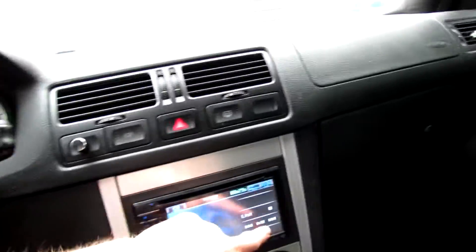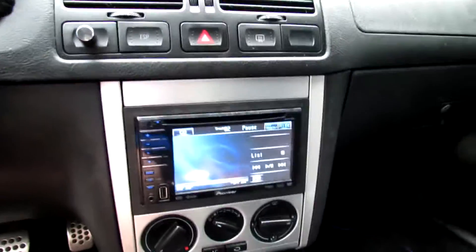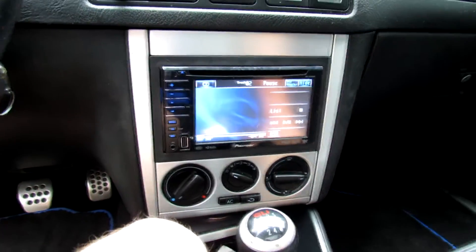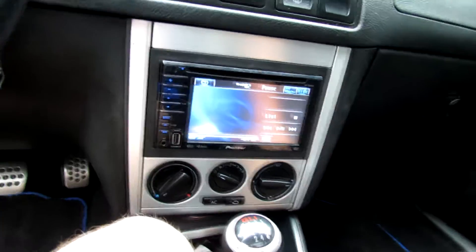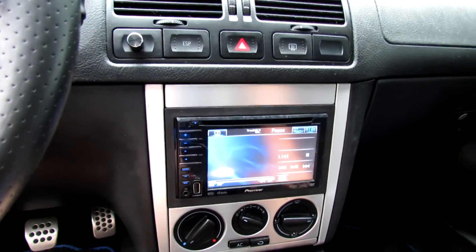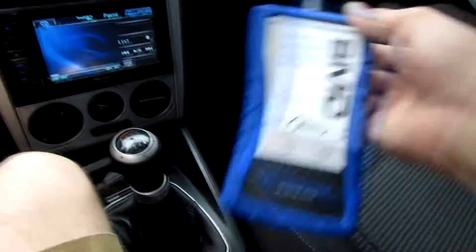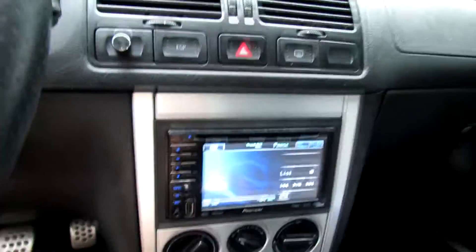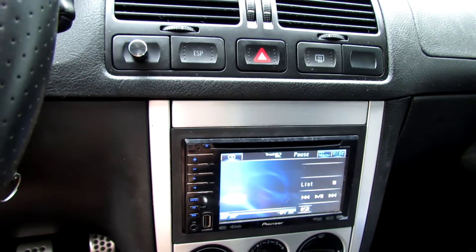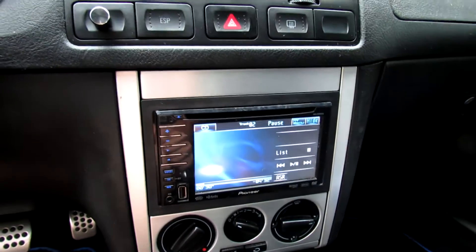While our sub-channel is only 36. The manual says to average them to get your maximum undistorted overall, but I personally would probably just go for my lowest distortion point, which would be 36. So yeah, that's finding your maximum undistorted volume from your head unit. I'm actually pretty surprised — my last head unit went up to 40 and had a distortion point at like 26. This almost goes all the way up, so thumbs up to Pioneer. Thanks for watching, guys.